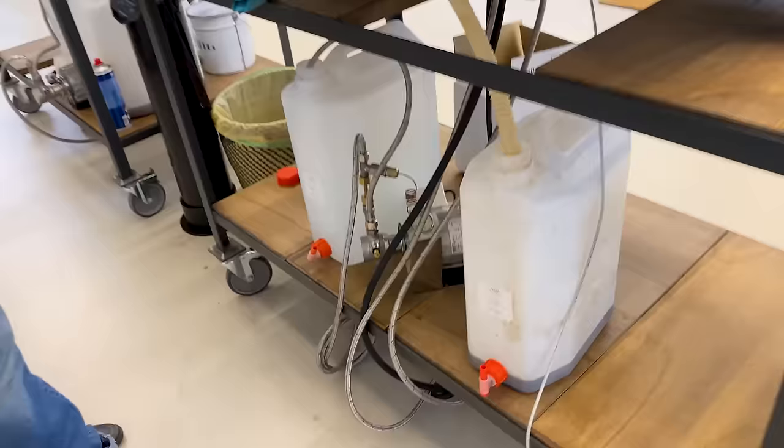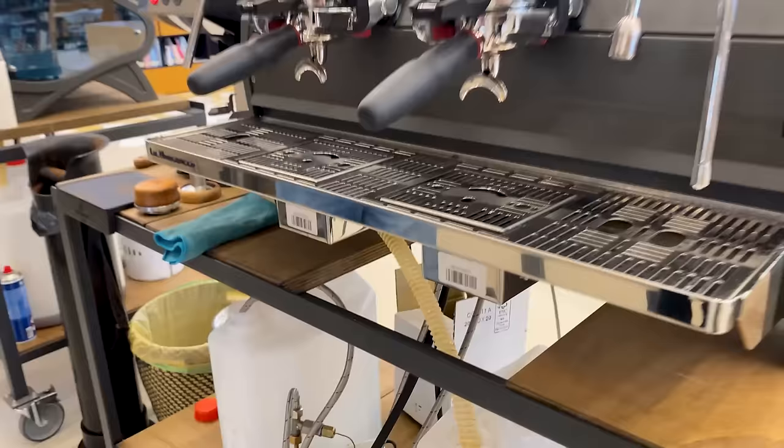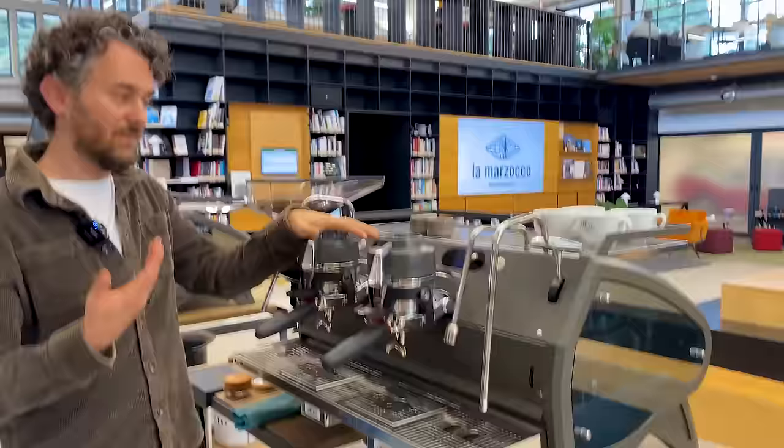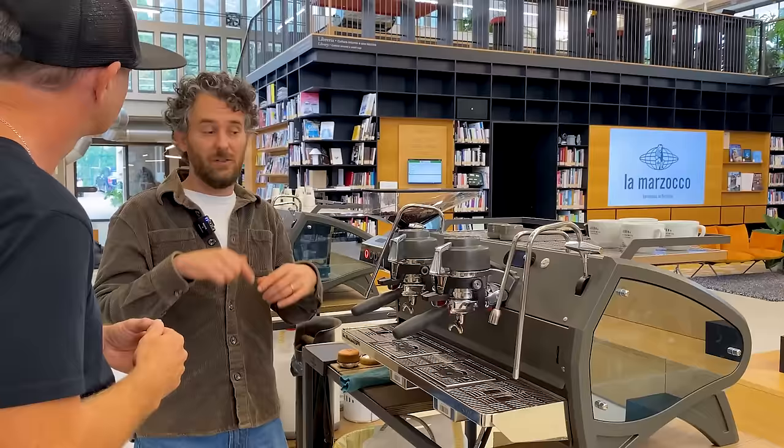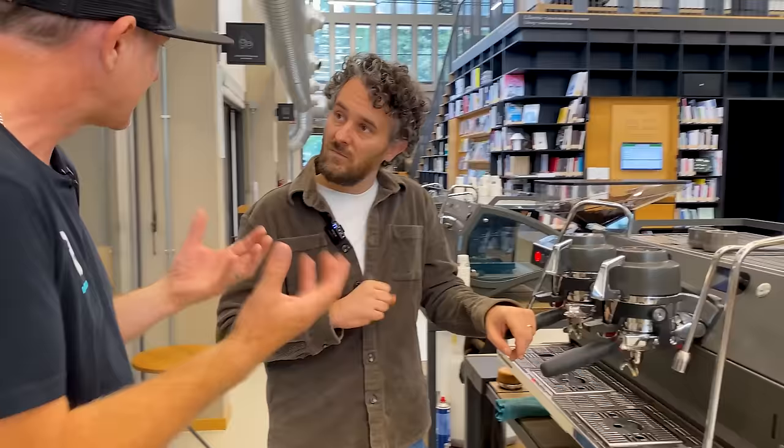It's all gear pumps. There is a main pump that works to fill the boilers and handles the first part of saturation. This machine has a new technology called smart saturation — the machine is able, for each shot, to detect when it's full of water over the coffee puck, so that once you start applying pressure you don't create channeling and holes in the coffee pack.